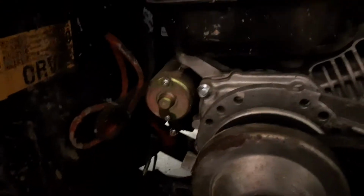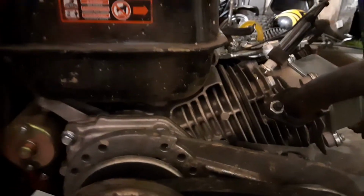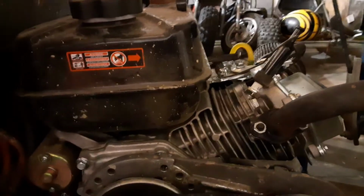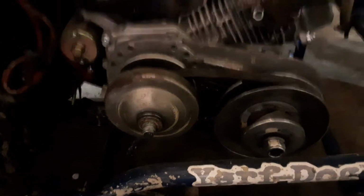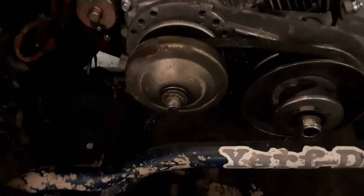But yeah. So anyway, this Tillotson is also electric start. It's a Hemi head, and 10 horsepower stock, but the way it is currently, it makes 11.5 horsepower, and it's 212 cc's, which is pretty damn good for a motor this size. You can't see the sprocket down there, but it's either 40 or 420 chain, and it's got a band brake kit.